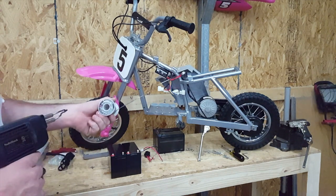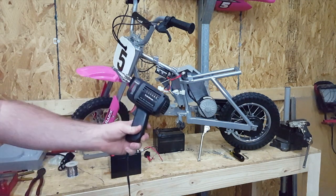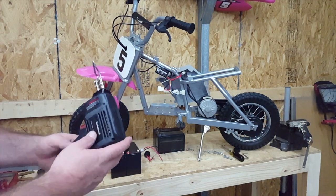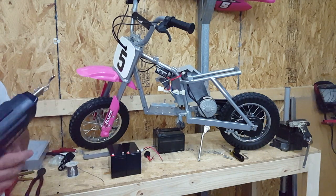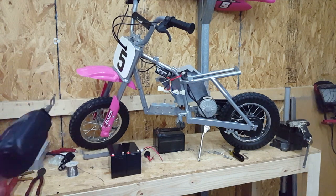What I have here is a 60-40 rosin core solder. I have an old Radio Shack 230/150 watt solder gun — it's got two speeds on it. A soldering iron — the pencil style — will work too, but they will not get as hot and it will take longer for them to heat up.